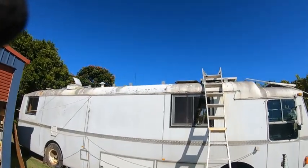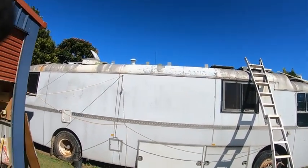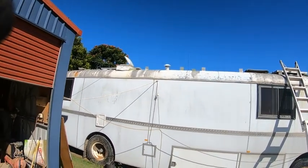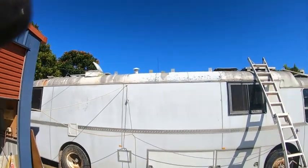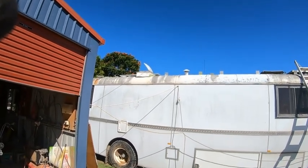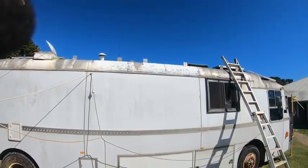So I'm a bit huffed and puffed. I'm going to have a quick cuppa. Then it's a case of get back up there. Sorry, Wells, I'm huffing and puffing. So next step, I'm going to get up there, and I think I'm just going to drill out all them brackets, get rid of them, give myself a nice clean space to work on up there, so I'm not going to be tripping over anything. Move that CB antenna over to the side there. I think there's enough lead. That's either my scanner antenna or it's my UHF antenna, one of the two. And then it's a terrible job of getting in and sanding, trying to find holes, patch it.